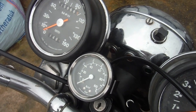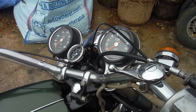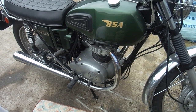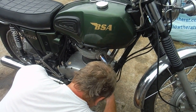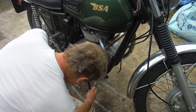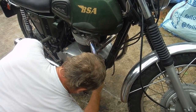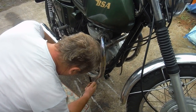Now what I'm going to do while my keen assistant holds the camera — I'm going to swap back from the oil pressure switch to the pipe to the gauge, and we'll see what the readings are on the gauge. Because if you go by the light, which is the original fitting that lights up when the pressure drops below 7 psi, everything looks okay. The figures I found for oil pressure on this, according to BSA themselves, were that between three and four thousand RPM you want to see about 40 to 45 psi on a pressure gauge.